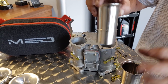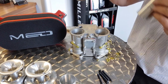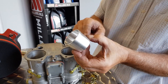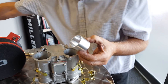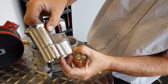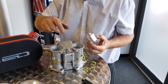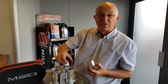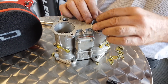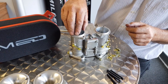As you take them out, that's the location. Now, what we have in our kit — this is a replacement section for the back of that ram pipe. Basically from there to there, here's that piece. If you don't put those in, the choke tubes and the venturis can rattle down. So drop that in — it drops into there. Drop the other one in on the other side.